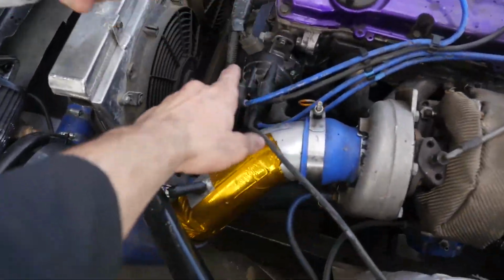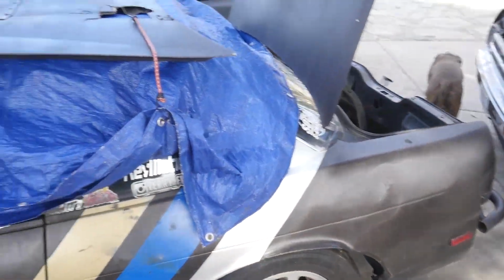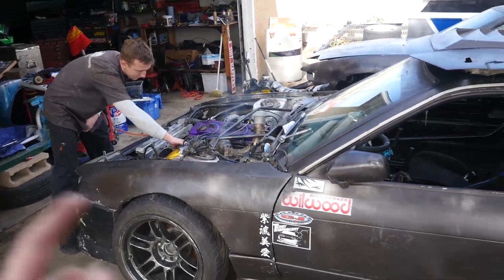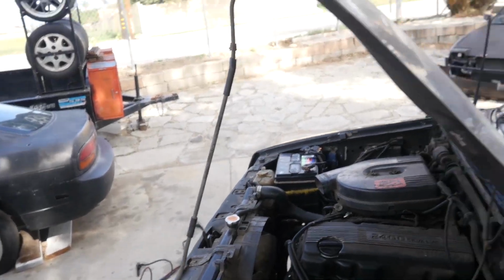So this was all low on power, the distributor, the power pack. Since it sits in the rain, a lot of stuff was just rusted and corroded, so we got that all cleared off. His battery is going low, so we just gave it the good old jump start from the work truck.